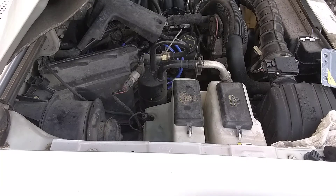After replacing it there was no noise, so now I know: if it starts making that winding or whiny noise when you operate your wipers and it's spraying, that means the pump is going out and you'll eventually need to replace it. Once you start hearing that sound, go ahead and replace it — with the new one it's quiet. I'll do a quick test so you can hear how quiet it sounds.